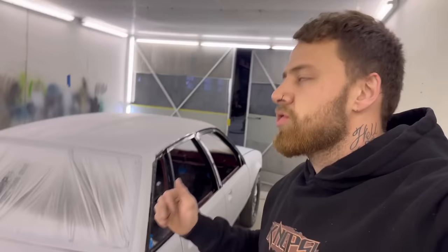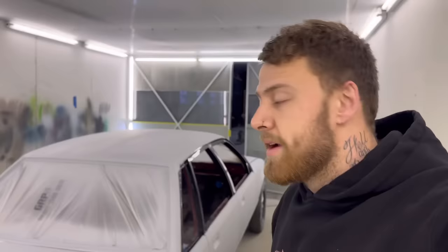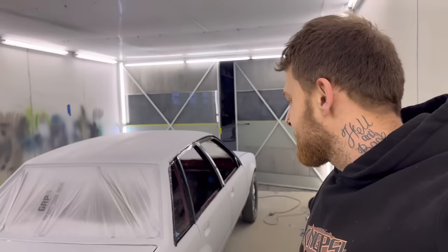morning. So straight on with the 600 grit on a soft block, go over the whole car, get it ready, wash it down, because at 11:30, Tow King's coming down here to pick this car up and take it to Chris's booth, so we don't have much time. I'm pushing this morning, so big push. Let's see if we can get done. So no rest, no breaks, straight in the job. Let's do it.